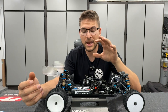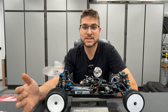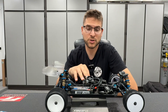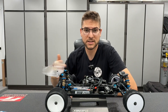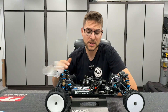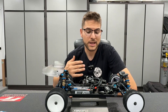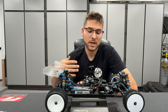Moving the fan on top of the motor gave direct airflow onto the stator and heat sink, and that made a tremendous difference. We're talking 30 to 50 degrees that I was seeing in the data logging. I was in the 205°F range and got it down to 150-145°F. I saw a couple of runs where after five minutes I was getting it down to about 138°F, which is dramatic.